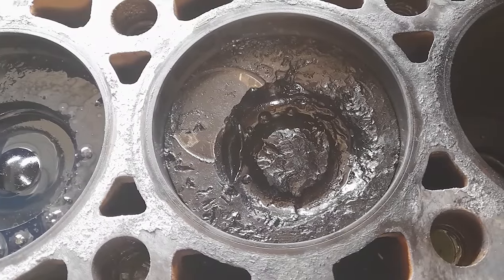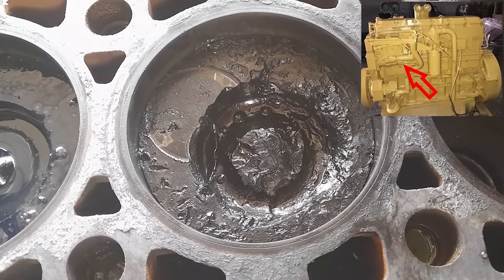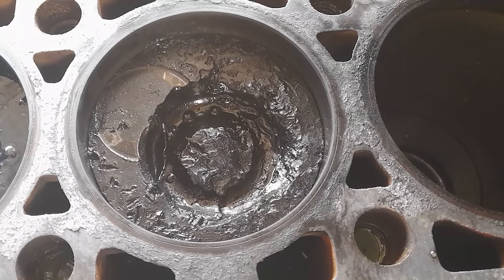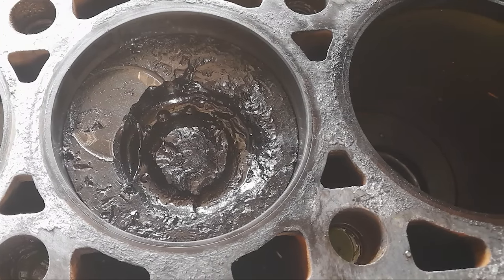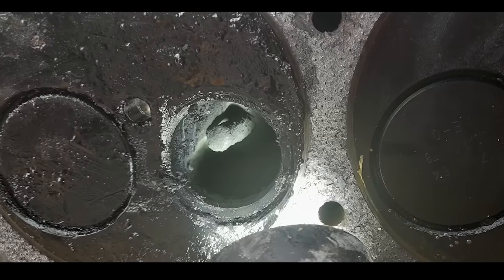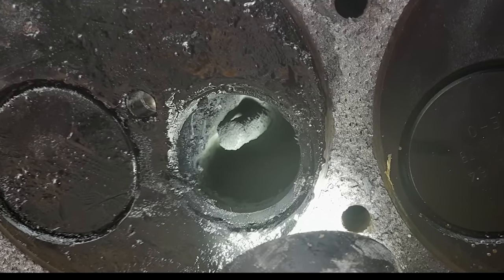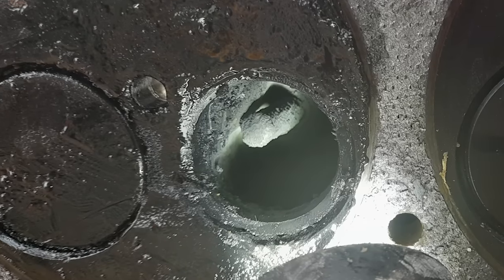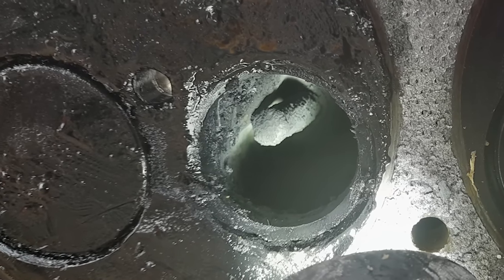In this week's Destruction of the Week, we have some pictures from Jerry — thank you, Jerry. A 3116. You can see it looks like a dropped valve into the piston. Piston's destroyed, cylinder's damaged. You can see the valve indentation right there, and there is where the valve head should be — the valve stem's actually bent over. That is pretty bad. Thanks to Jerry for sending these pictures.